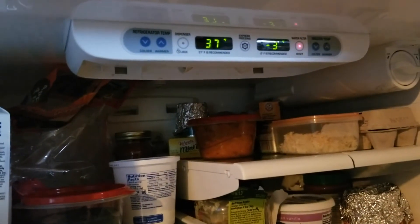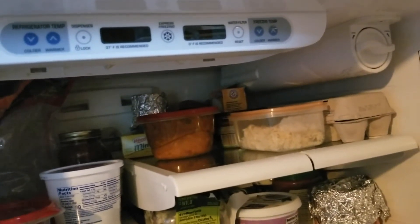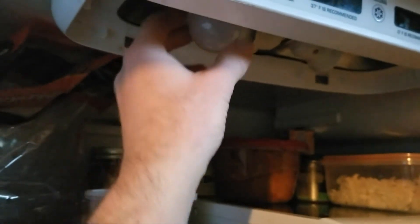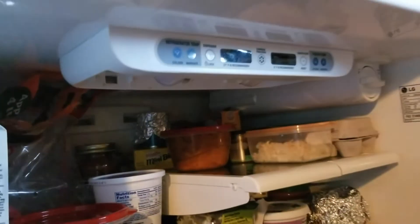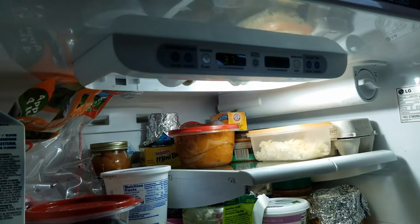We're back inside the refrigerator now. For safety purposes, I'm going to push down this button and cut the circuit to our main control board. Then I'm going to screw in the light bulb. As you can see, the control panel is off. Basically it's as easy as screwing in our new light bulbs, one on each side. There's one, and then let me screw the other one in on the other side. With the light bulbs in, we're going to release our button here and bring power back over to the control panel.